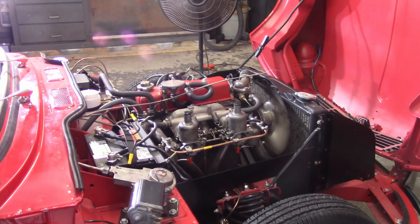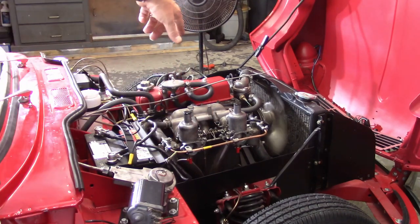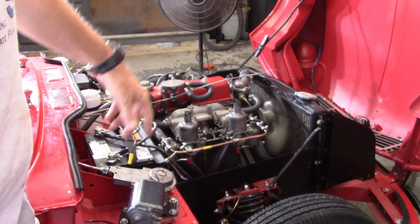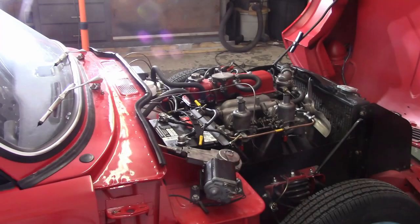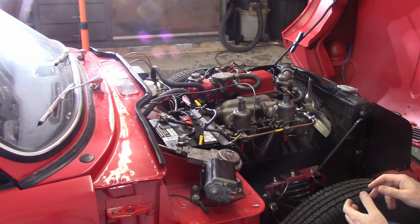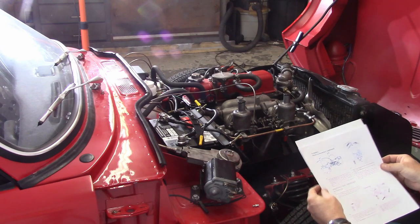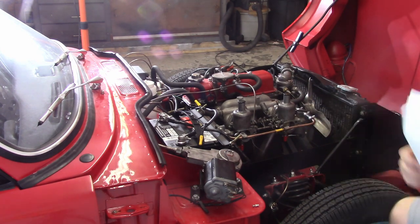I think that's halfway decent. I've tightened up the throttle linkage screws and the choke screws. I'm going to get that choke cable out of the way, take it around the block. I've also discovered a brake leak at the brake caliper. I think I'm 90% of the way there, so we'll take a quick trip and see how it did. It definitely did better — it still doesn't feel like I can really get on it without causing it to bog down, but it'll drive. Now I want to adjust the choke — reconnect the mixture control wire with about a 1/16 inch free movement before it starts to pull on the jet levers.